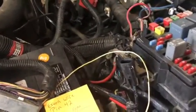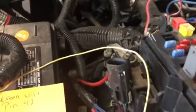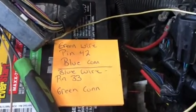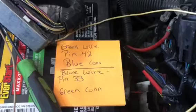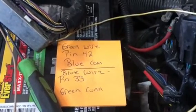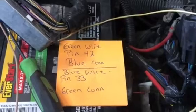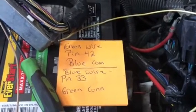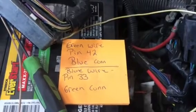After you do add this to your '03 and up trucks, you will have to have somebody with HP Tuners or EFI Live program the computer to kick on the fans. You can change the fan settings from factory, but you also do have to modify the AC pressures. If you have an '03 through '05 and a half basically truck, you will have to modify the AC pressures in order for the fans to kick on correctly.